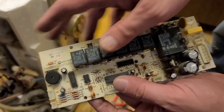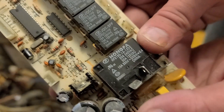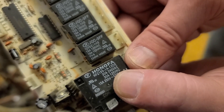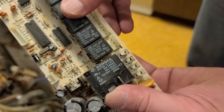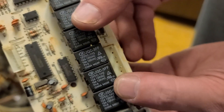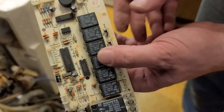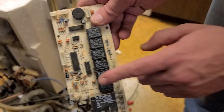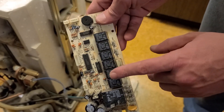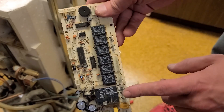Here's a quick look at the control board — the other half of the brains. There's the beeper. This is a really heavy-duty relay for the compressor motor, rated for 15 amps at 250 volts or 30 amps at 125 volts — that's what's starting the compressor. That relay is worth desoldering and keeping. There are also six more normal 12-amp relays controlling the various fans with their multiple speeds, the reversing valve, and other functions — so there are seven relays total on this board.